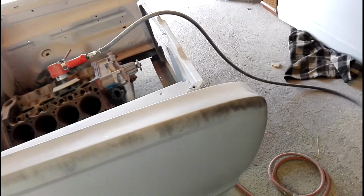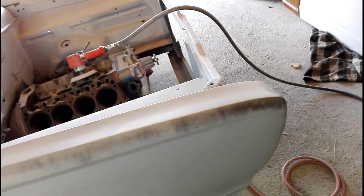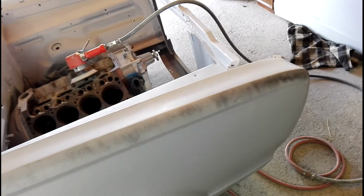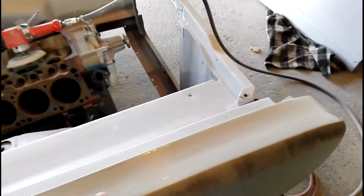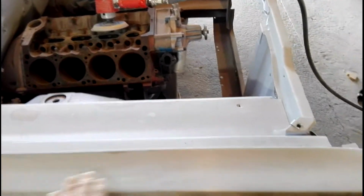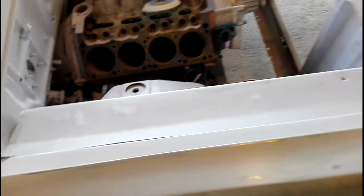Since I can sort of see and think, well, I'm getting back down to that grey again, or I might need a little bit more material on instead of blocking hard back. Especially in these areas, if I'm coming back through to grey or something like that, in spots, I know I'm getting close to steel again, so that's quite a good guide too.